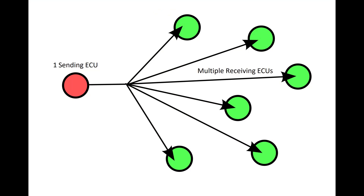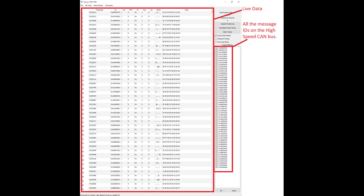One of the fundamental operating principles of CAN is that every ECU on the bus receives every message, even ones not intended for it. If an ECU receives a message that wasn't intended for it, it simply ignores it. This also has the effect of being able to very easily set up broadcast or multicast messages that multiple ECUs can react to. With this in mind, there was likely a frame that contained bits encoding the dashboard brightness value and the ignition status somewhere. If I could manage to find the message that contains the status of the buttons on the steering wheel, I could also use those as a way of controlling my microcontroller. The method: trial and error. By organizing all the messages by ID and watching the data on each one, you will eventually find a message that changes in response to the button you're pressing. Once you know what message to look out for, all you need to do is write some code to watch for that message ID and parse the relevant data, just like any other ECU on the bus.